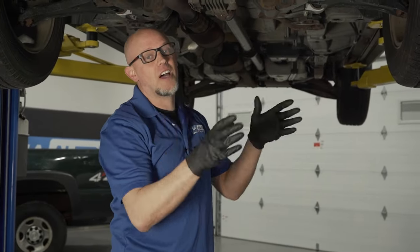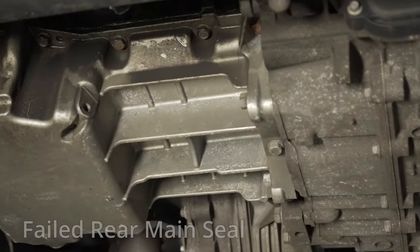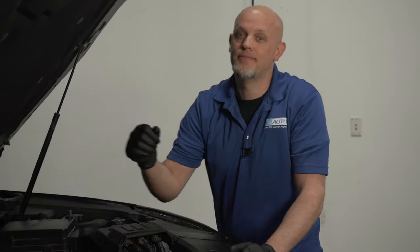If you notice that you have a lot of oil pouring out of the vehicle in this area, most likely you have a rear main seal that has blown out and is leaking oil. For some reason, this seems to happen more in colder temperatures. It has to do with the PCV system — the intake on this vehicle actually has a hole that's part of the PCV system, and it will get clogged up. When it gets clogged up, there's too much pressure in the crankcase and that's what blows out the rear main seal. The fix is to take the intake off, find that hole, and use a drill bit about that size to clean out all the carbon buildup.